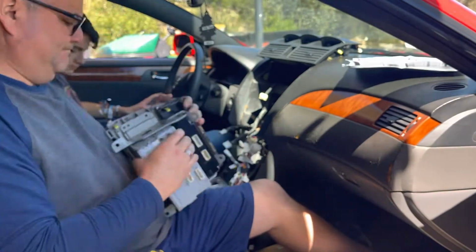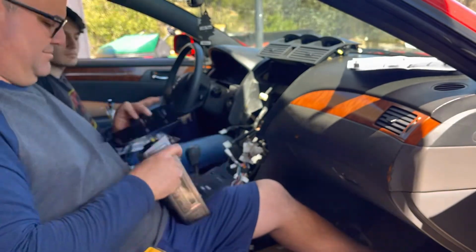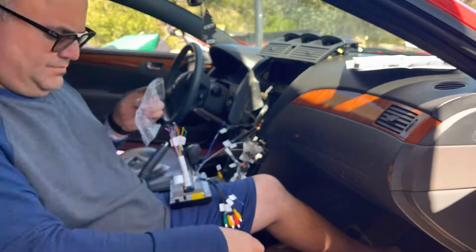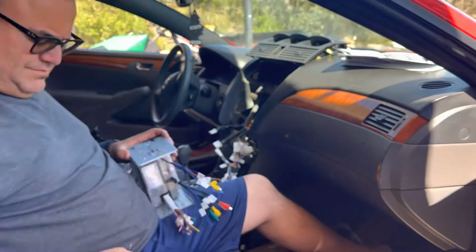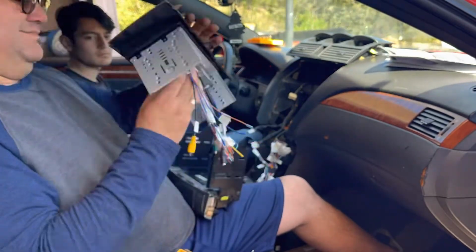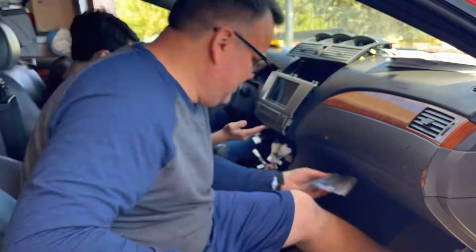So because this PAC is intended for Toyotas, it's very similar to my 2008 Tundra. I had to use those 2 connectors that were talked about earlier, as well as the input using the right power. The OBD2 sensor cable is really to pull power if you don't have any power in your vehicle, but if you have red and yellow, you should be good.